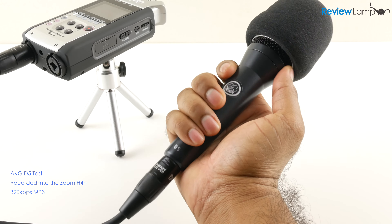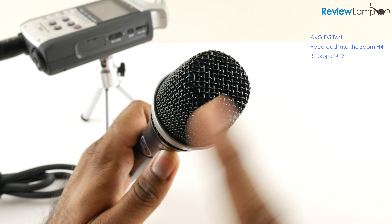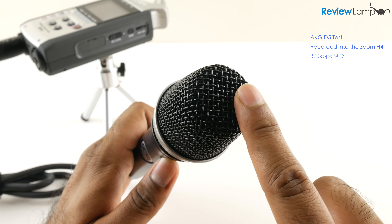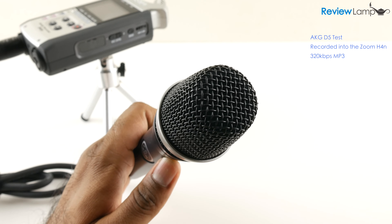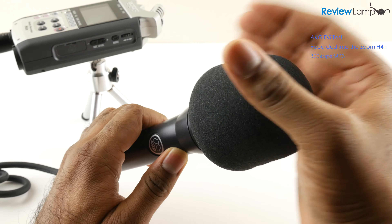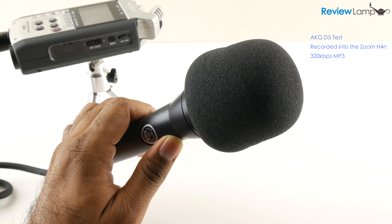This mic is meant to be a handheld microphone and I'll be testing it handheld. The D5 has a super cardioid recording pattern so it rejects a lot of background noise and off-axis sounds. It really sounds best when you speak into the top of the microphone and are quite close to it — about 2 inches produces the best quality. To reduce the impact of plosives, I've also installed a windscreen. I'll put a link to one that fits in the description below.